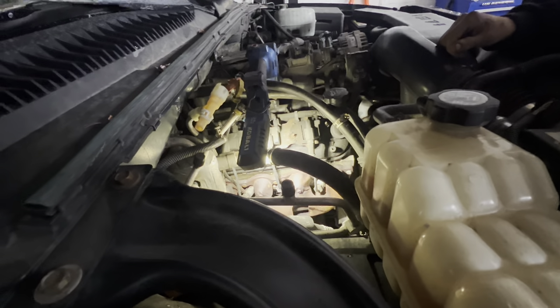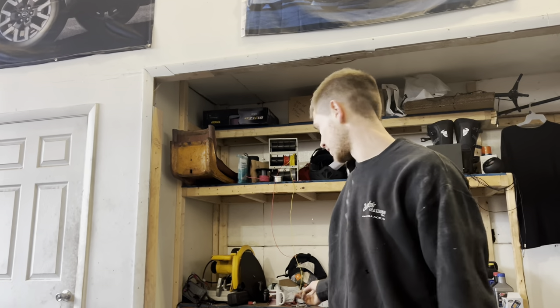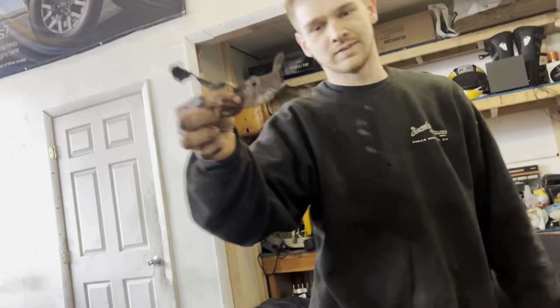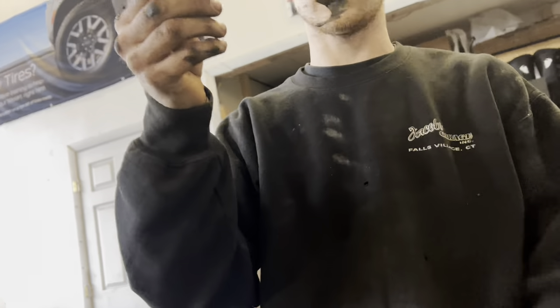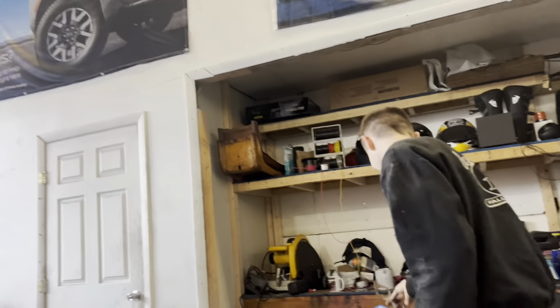Should you warm it up first? I drove here. You have to do it when it's ice cold. Don't touch a manifold when it's hot because you'll burn your hand off. It was ticking and I didn't really know it because if it's lightly going and you're driving, you don't hear it. I unbolted the manifold and pulled this off — this is how it looked. That's why it was leaking. The bolts loosened up, I didn't hear it at first, then I heard it, was being lazy, and it burned the paper off.